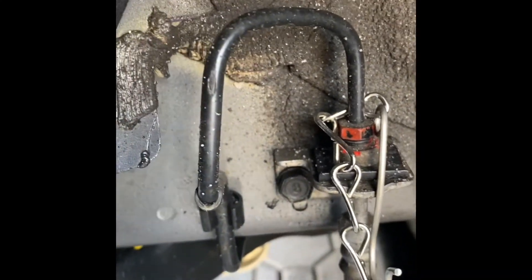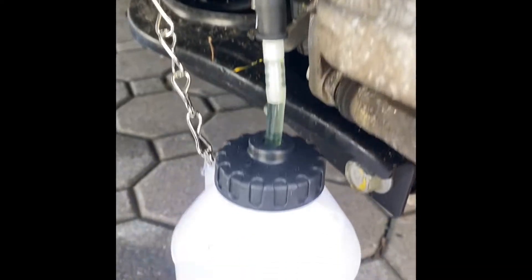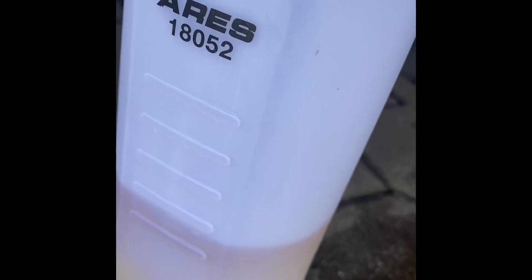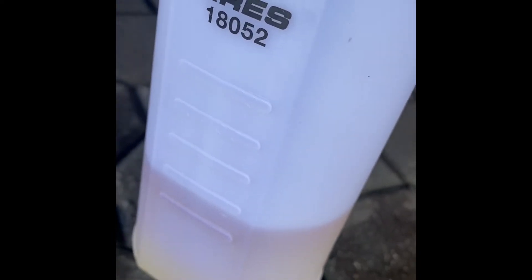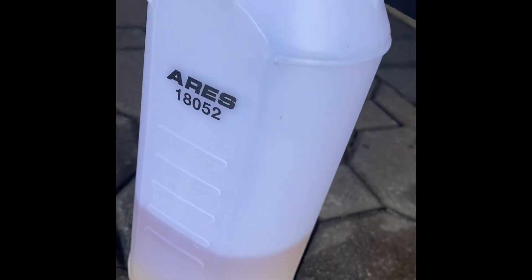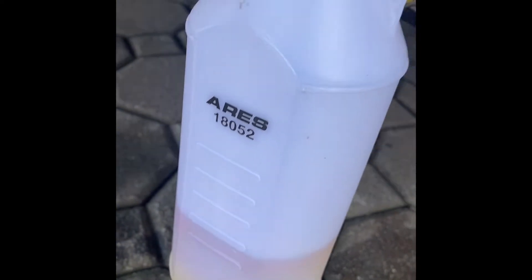That line is going to rise. I'll let it run until it gets up about two lines — that should bleed the entire line since this is the diameter of the brake line and it's very thin; it doesn't take a whole lot of fluid. I have two quarts of brake fluid so maybe two lines is a little excessive, but once I open that can, I'm not reusing that brake fluid. Whatever's left over I'm throwing out, because once the can is open it's susceptible to absorbing moisture.